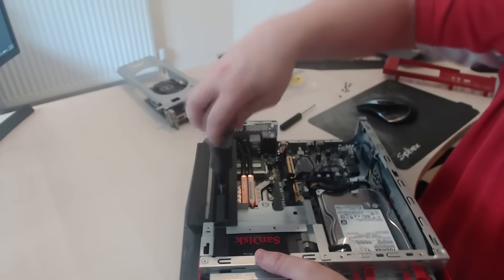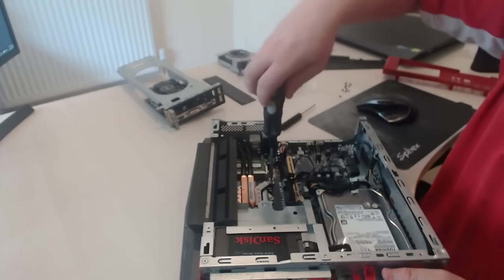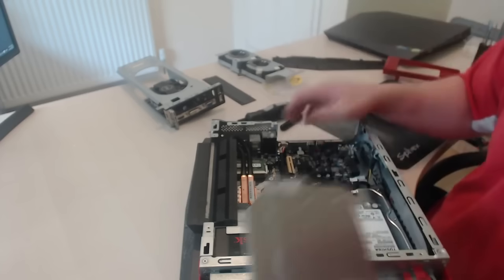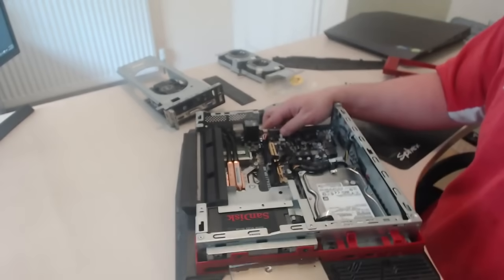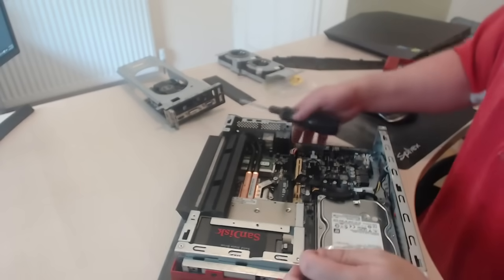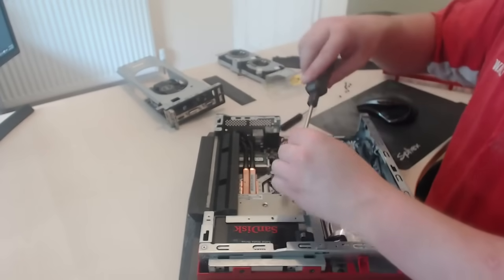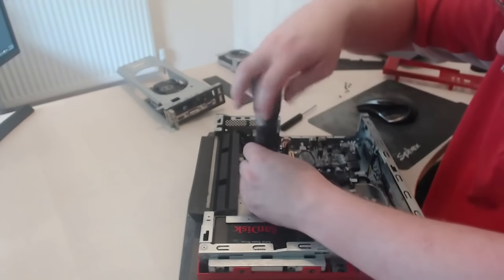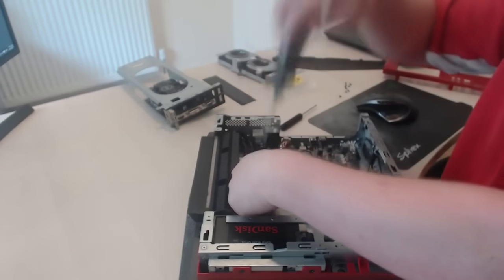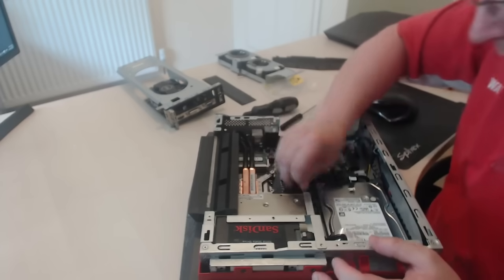So I've just done that short step. Once it's all done, the next step is to get your optical drive again and put it back into the tray underneath. Slide the optical drive in there, put the screw back into the hole, then once that screw's back in, connect the plugs back into the drive.